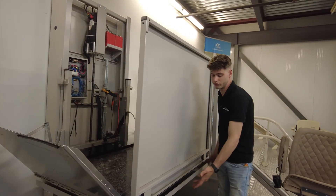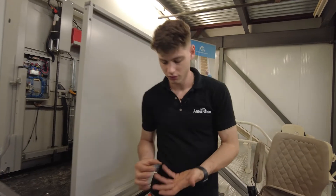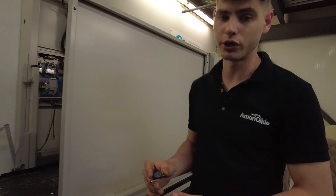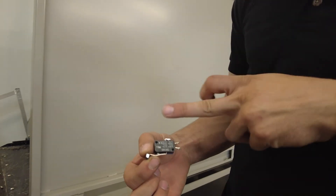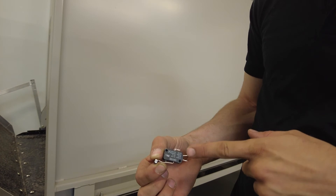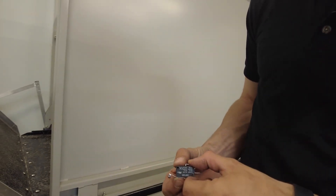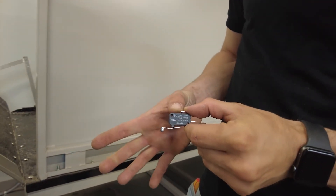The next step would be to remove the underpan and look at the micro switches. They're the same type of micro switches as before — same connection points. Make sure it's top and bottom pin; we do not use the middle pin. The switch must click and unclick. If the switch is activated, it is not good — we need them to be released.